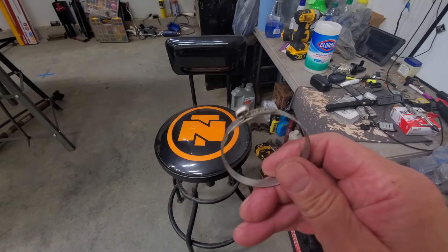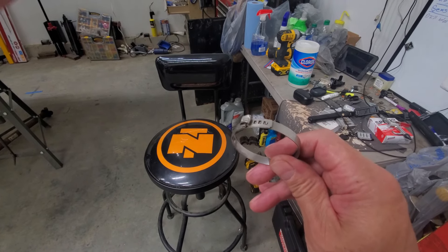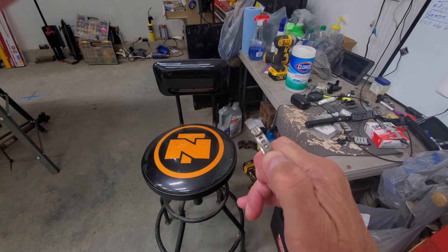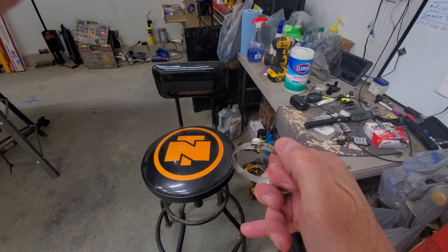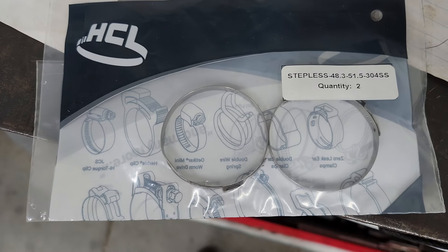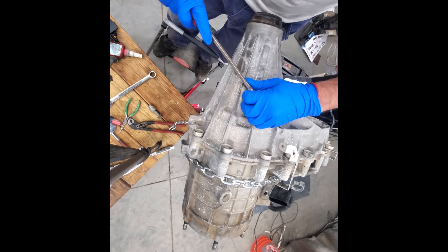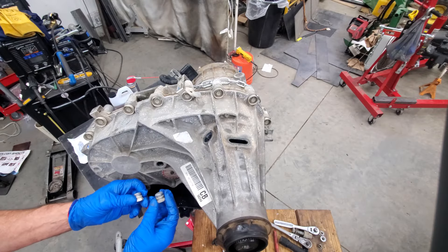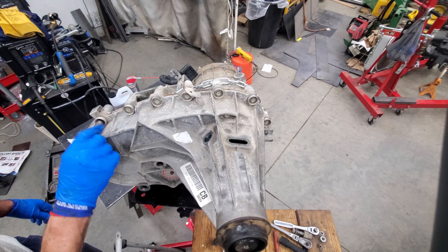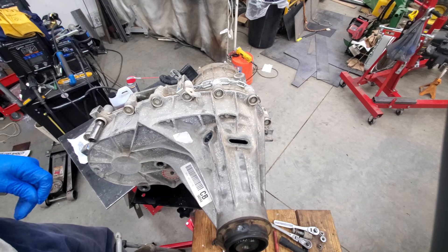There's a non-reusable clamp holding the boot on the front drive shaft covering the spline, one on each side of the boot. I took this one off on the transfer case side and left the boot on the drive shaft — just pry up on it right here and it pops across the locking tab. You'll need replacement clamps, so I got mine on order and I'll put a link below. Pull this rubber plug out, then remove your fill and drain plugs — I already drained it while it was in the truck. Take a 10mm socket and pull all the case bolts out.